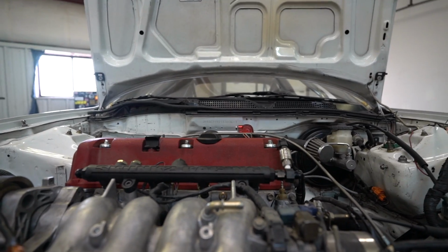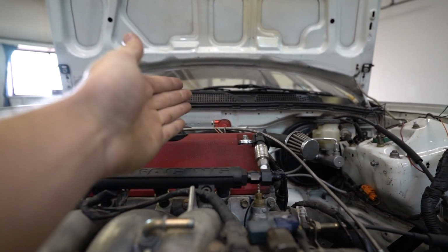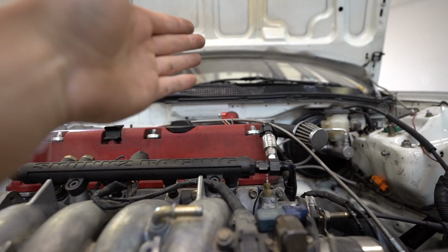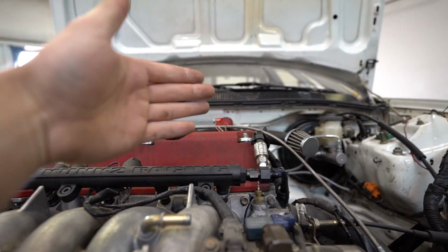I shut the hood, and I actually did lower it down a little bit, but I shut the hood, and the hood actually sits up above the cowl there about an inch. So this actually leaves room, as long as the compressor housing will fit, for a bigger frame turbo. Like an S369 frame is really similar to the frame up from these Precisions, like a 6870.